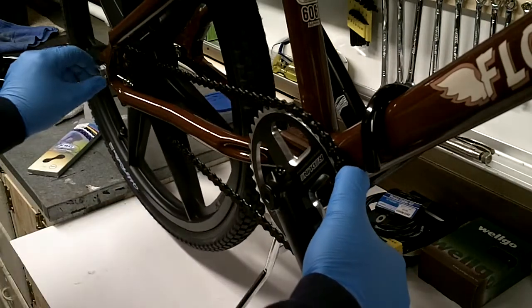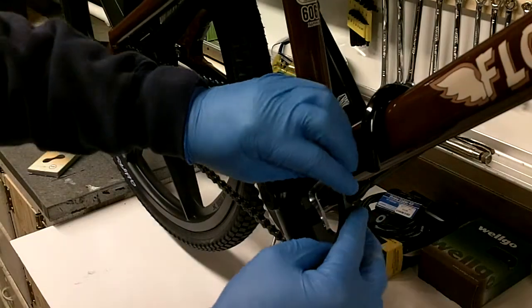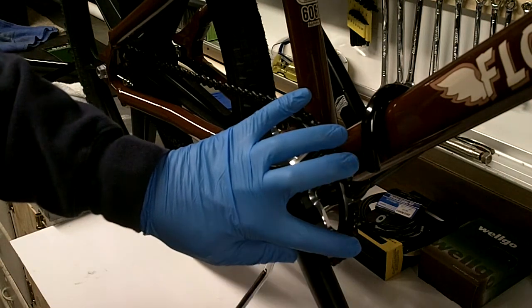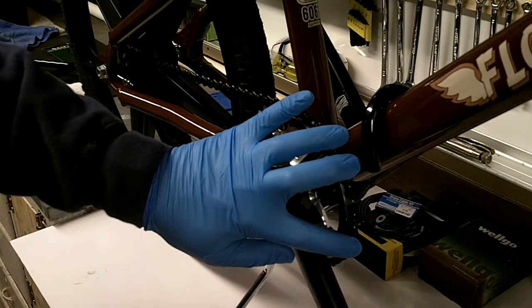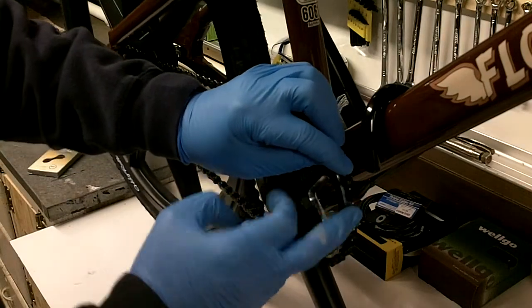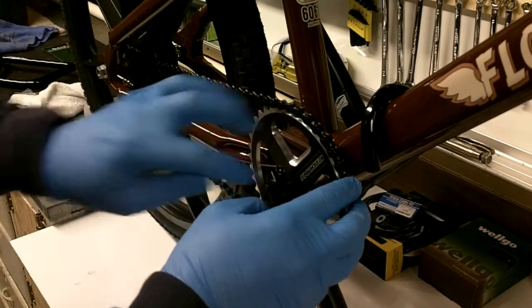Well, my bolt back here is loose, so the wheel slides back and forth. That way I can make sure I get it the right length. Then all I did was wrap it around, see where it needed to be. Use my chain breaker. Squeeze the link out like that. Now it's the right length, and all I have to do is install the master link between those two links right there, and it'll be ready to tighten everything up.